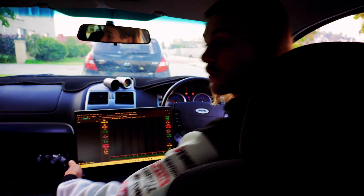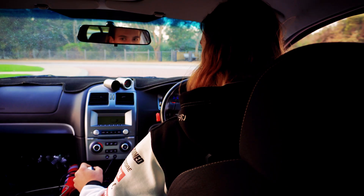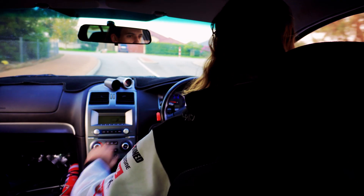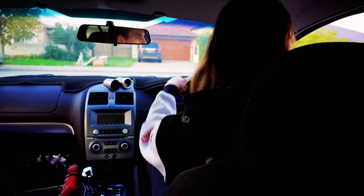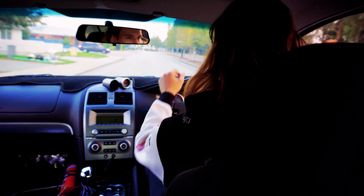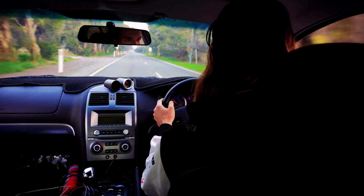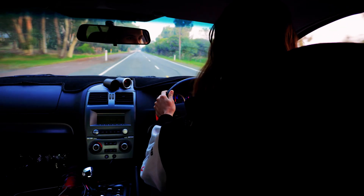Put it in reverse — let's do it. Second gear is pretty fun, I've given it quite a bit of timing above like four and a half. Today we're just sort of getting our AFR targets on point, doing some more data logging, getting to areas that struggle to get to on a dyno. So then when we go into a dyno we can tune our variable cam timing for best efficiency.